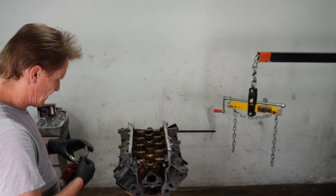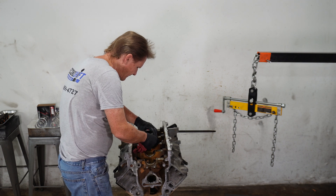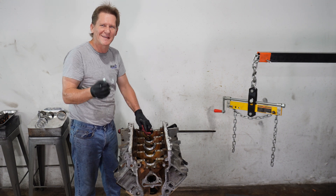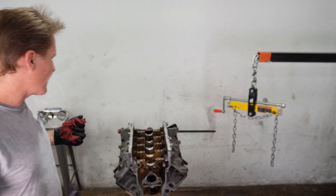We're using Sealed Power bearings going back together. A lot of people have a lot of different things to say about different kinds and brands of bearings. Sealed Power is what your local auto parts store will sell you — they're made by Federal Mogul, a brand that's been around for a long time, and we have no reason not to trust these bearings. We've already wiped them all down with acetone and inspected them for any nicks. I'm always amazed at how just one tiny little tab on one side can stop the whole bearing from wanting to spin.